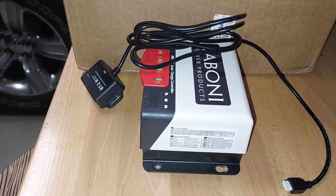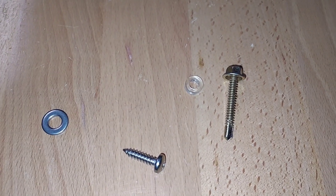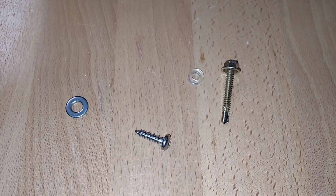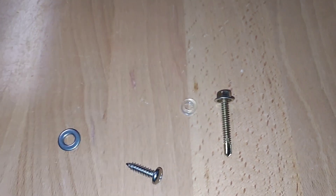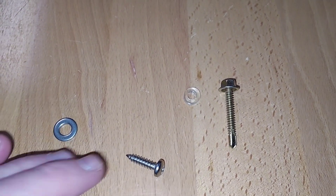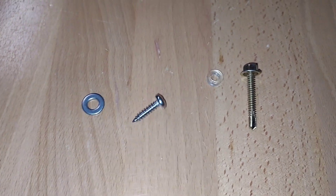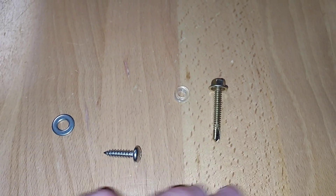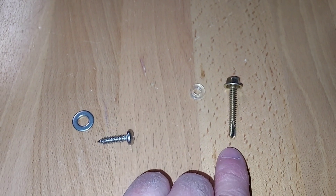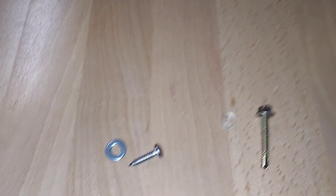There's my old solar controller — I might use that here at the house if I buy a couple of panels. Anyway, I forgot to give the reason why I used the shorter screw. I was reading online that they do attach wires and stuff to the rafters in the ceiling of the RV, so I didn't want an inch and a half screw going clear down there — maybe into the ductwork for the air conditioner. That's also why I didn't use the self-tapping screw that comes with the kit; I don't want an inch and a half going clear through when it's only 3/8" thick.